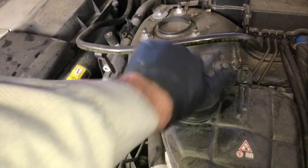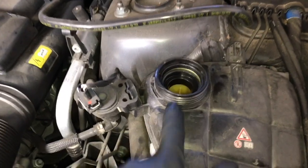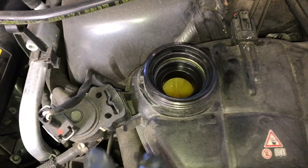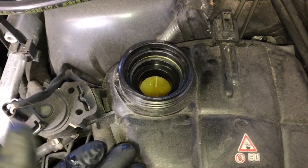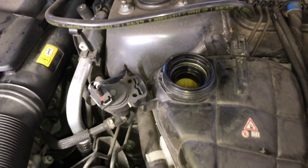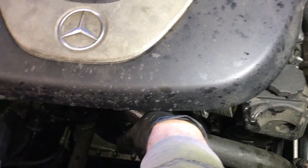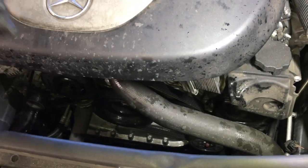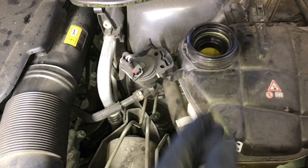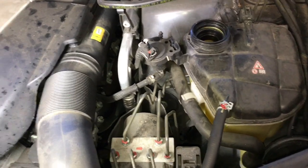Now we're going to remove the radiator cap and fill it up with a Mercedes-Benz approved coolant — I'll link that up in the description. Fill the bottle up with coolant until you reach the top of the little hash mark inside the bottle. Don't overfill — this is an expansion tank, and if it gets too hot with nowhere to expand it will pop the bottle. Fill it just to the top of that line. Run it until the thermostat opens up — you'll know the thermostat opens because this hose will go from cold to warm after about 10 minutes of running. The coolant level will most likely drop, so top it back off to the hash mark inside the bottle, then reinstall the cap.